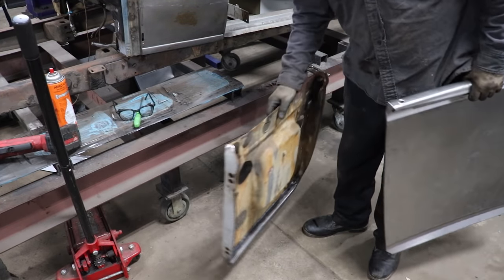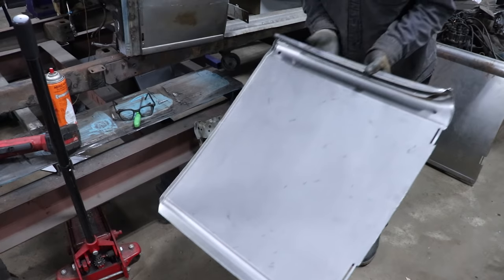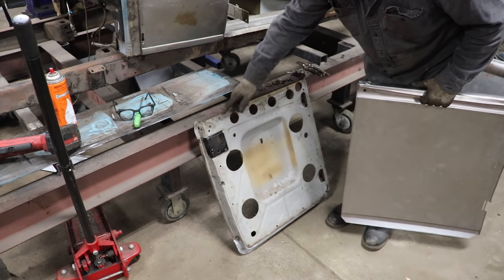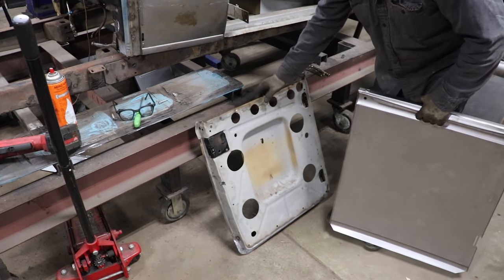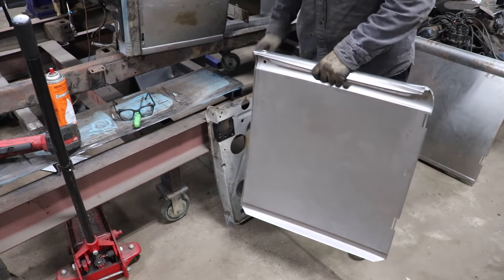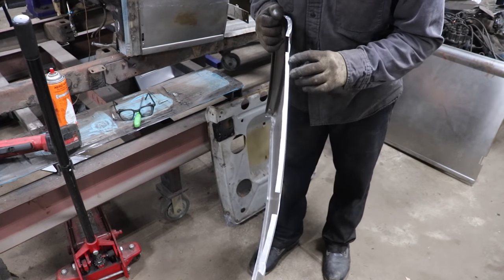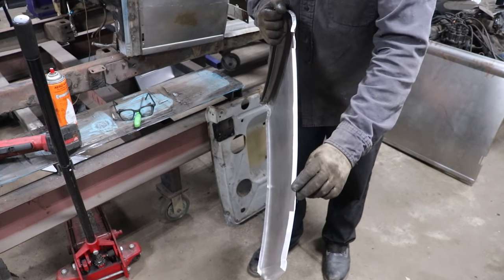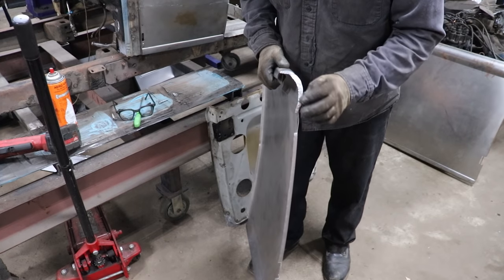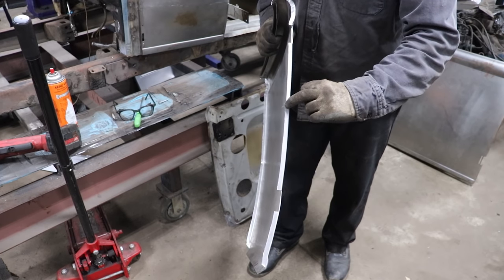So I got the inner structure taken off at the top little layer, basically this little lip that sits right in here that's spot welded. Like I said in the first video it was easier to just sand the spot welds and peel the little piece off. So I got that off and you're left with this inner structure here. This is the skin that we got. It seems to be pretty decent quality but you can tell that a lot of this is done handmade because I can actually see where they used tin snips to cut this along and it looks like it's been hammered and dollied and messed with.